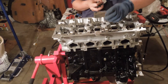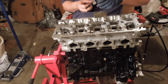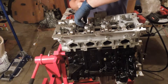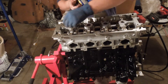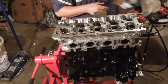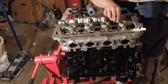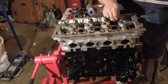These are upgraded PT Cruiser style cam followers — they're also basically rocker arms. They're much stronger and hold together better, and I do suggest these. There's actually a recall on the factory ones that are not upgraded — they're doing a campaign on them. I haven't had any problems with mine in the stock engine I have, but just to be sure I'm going with these. I was trying to look for something alloy, but they don't make it, so I'm sticking with what I can get.